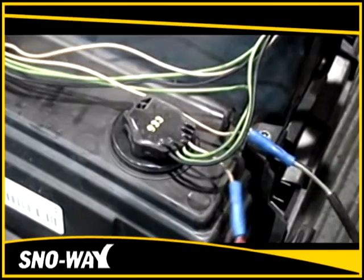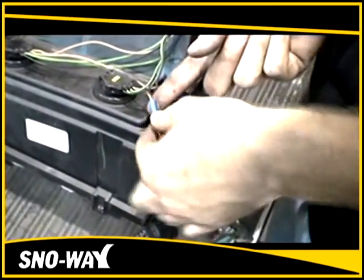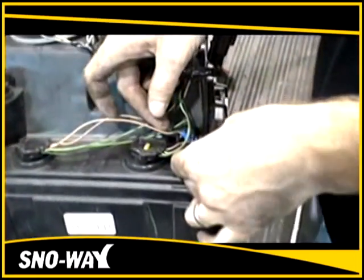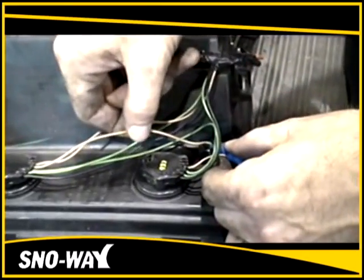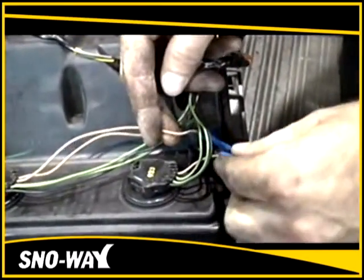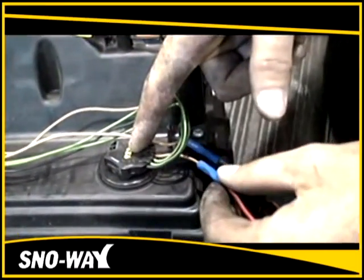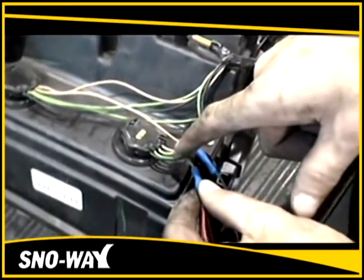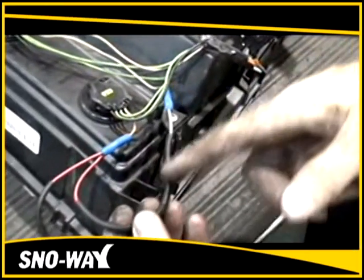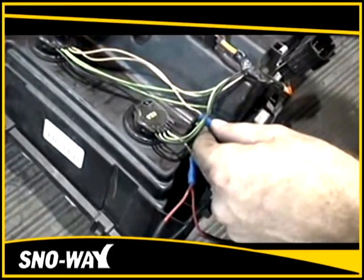You're going to find the wire with the diode that has the red wire and butt connector on it. At a suitable distance, find the turn signal wire using a test light or a meter. Cut it in half — the red wire connects to the wire coming out of the secondary bulb, the one with four wires. The gray wire with the diode you will butt connector to the opposite wire coming from the primary bulb.